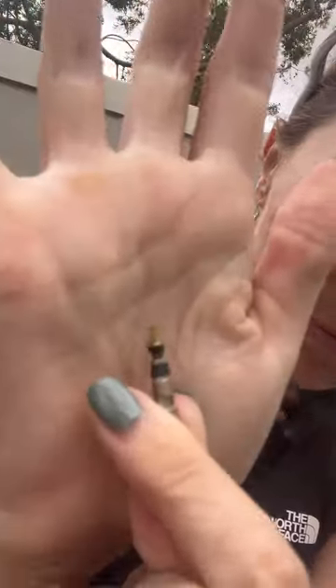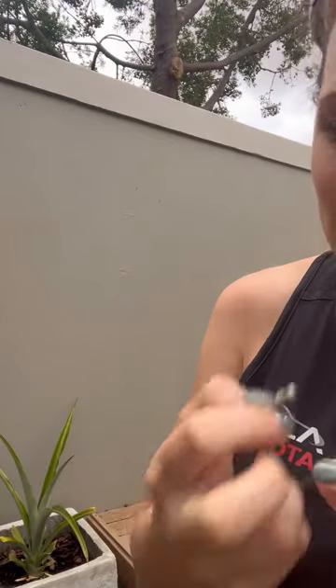As you can see, it's very rough and grimy — not ideal, which means air is going to struggle to get in and out. Not cool when you're standing next to the road trying to pump up a tire and your valve core is stuck. This one's actually not too bad. Easy to check — just try and blow air through it.